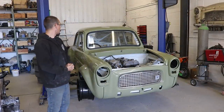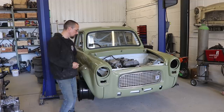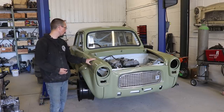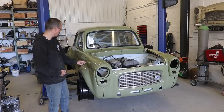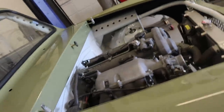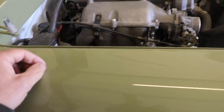Alright, so that's all the paintwork on the car finished now. It's been a hell of a job. Obviously we're doing everything twice, and all the little things that have gone wrong through the process. I've actually ended up painting these wings twice as well, and still managed to get some paint runs the second time. The first time I had loads of these little pinholes, there's a little hole there that goes right down to the primer, and for some reason I had them all over the wings. I panel wiped them beforehand. I had the same issue on the boot lid, but what I did there was get a little brush and dot some paint into the little holes.